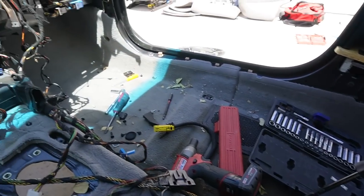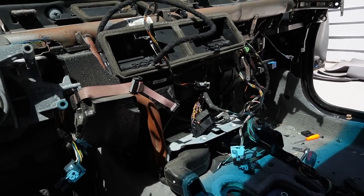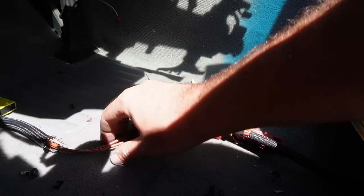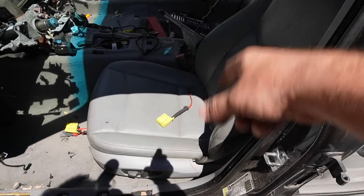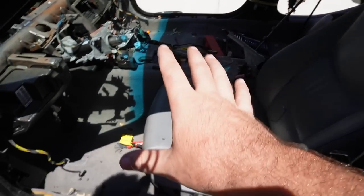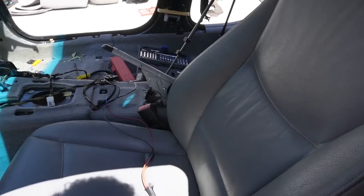After a little bit of time, we did get the passenger seat out, a lot of the trim out, and the dashboard out - all very good progress. There's still a lot of wiring, which is kind of scary - not sure how I'm going to reroute all of this. The driver's seat will not come out though. I peeled back the insulation and found this harness has two positives and two negatives, while the passenger-side harness only has one of each - so it won't work on the driver's side. I'm heading to Pick-n-Pull right now to get the right driver-side harness.